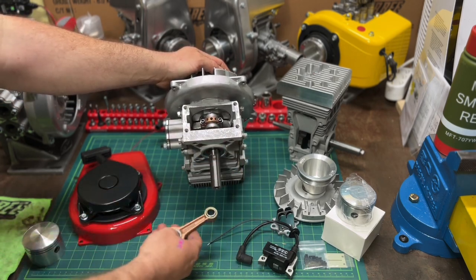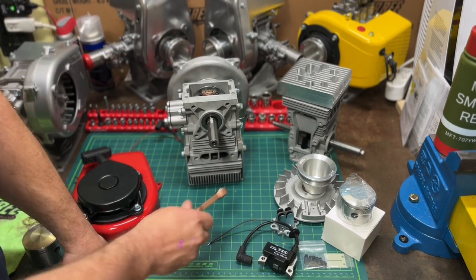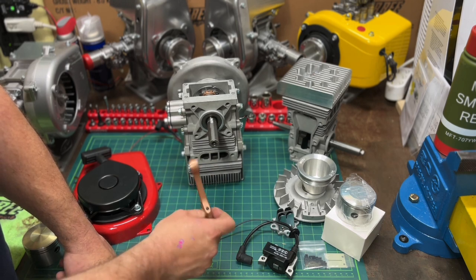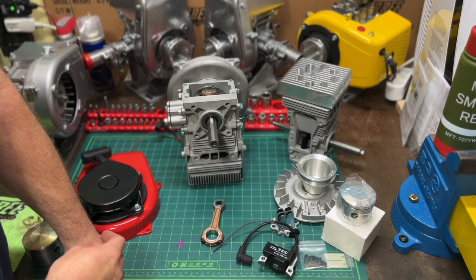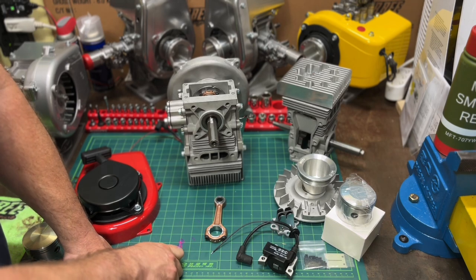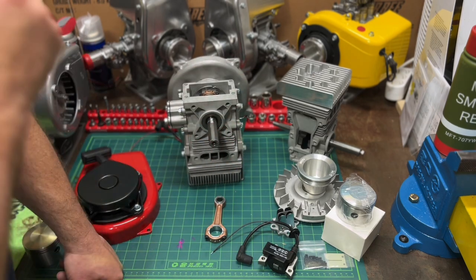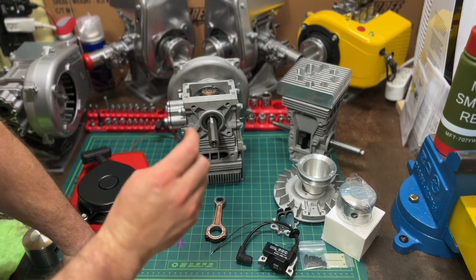Same quality parts — John Wall took his connecting rod and piston up to 13,000 RPMs and it held together, which is a testament to the quality. It's the strongest design they've ever been. Those plus the 180,000 PSI rod bolts are more than enough for a utility engine, and as proven on the tracks, good enough for the race-ready engines.